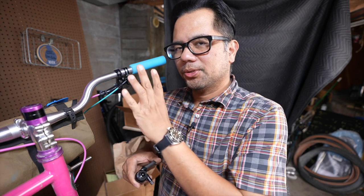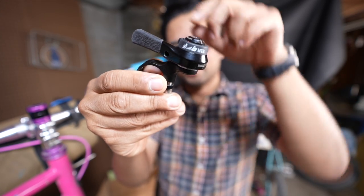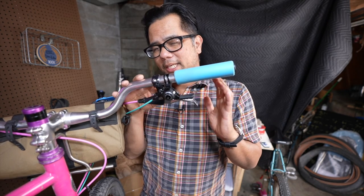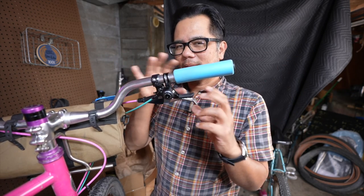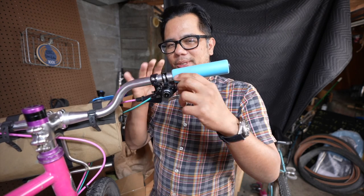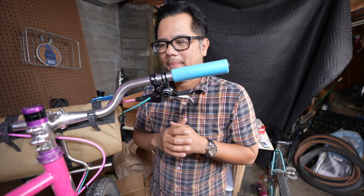There are a few downsides to this setup. A typical thumb shifter for the rear derailleur — this one by MicroShift — has a really long throw so it works with modern 11 and 12 speed derailleurs, things like SRAM Eagle, with enough cable pull to drag a mountain bike derailleur all the way across a cassette. The front derailleur shifter in a pair has much less throw since front derailleurs haven't seen much evolution since the nine-speed days. From my experimentation, the front shifter can pull enough cable for a nine or ten speed rear derailleur, but not enough to shift a modern wide-range mountain bike cassette across the entire range.